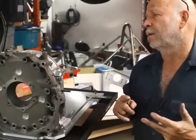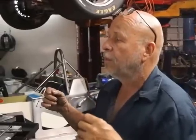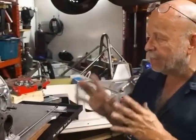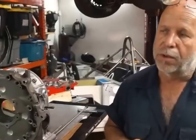The balancing is absolutely critical. Each rotor has to be exactly the same, both dynamically and statically. The dynamic balance has to be, at least in my book, within two to three tenths of a gram. And yes, they are within that tolerance. You have a front and a rear counterweight which take into consideration the imbalances created by the rotors. Once we balance the completely rotating assembly, the actual front and rear counterweights are not quite as critical, but they're still critical.